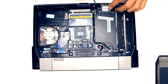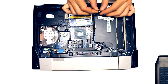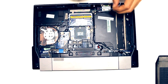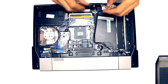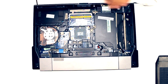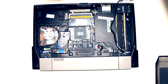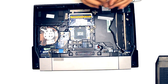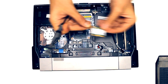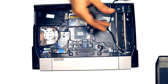This is the Wi-Fi card — it always has two wires. Sometimes there are three, but if there are two you will find a white one and a black one. You will also see labeled on the sticker that white is marked with a white arrow and black with a black arrow, indicating the location of the two wires. If there are three, you will see an extra gray wire for the central antenna. The card is held by just one screw — you take the screw out and then remove the card.